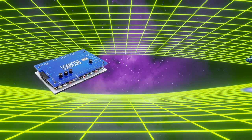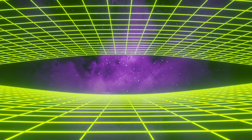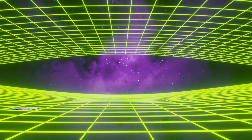For the test setup I'm using the GBSC as the main scaler. For all composite video inputs I'm using this little thing — a composite-to-VGA converter. It turns out it's not great but it has its uses, and it has very low latency. It then goes from the scaler to a capture card, which adds a little lag for me, but that's fine. After that you have the input to my screen so I can play the games.